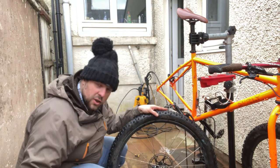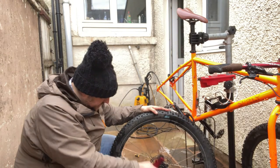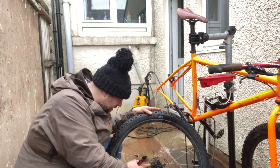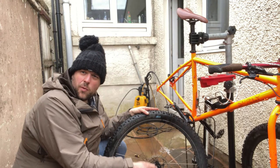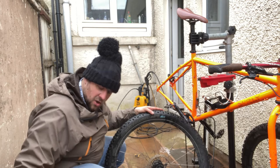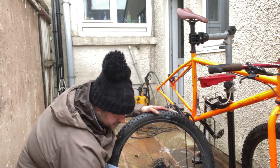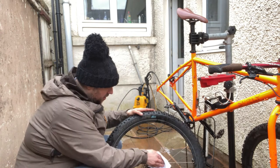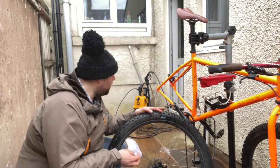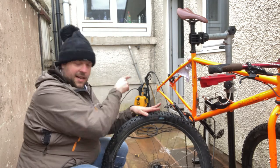Getting behind, that's what the long bristles are really good for. So having a look, we can inspect that disc again, and we can see there's some discoloration and wear here. It's actually better than the one on the front, but still something I need to be aware of, put on the list. And using a clean cloth with nothing but a bit of water on it to wipe any dirt off. I'm going to put that here because I'm going to use the same cloth for the disc caliper.